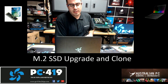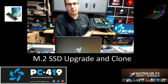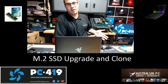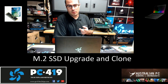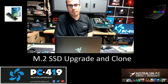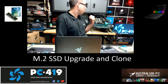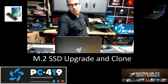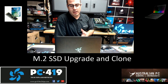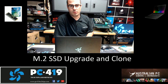So as you can see, it is a bit of a process cloning your drive, but it's not a very hard process to be honest, if you've got the right tools and the right software. If you've got a model that supports two M.2 NVMEs, you'll be able to do this in a 10–15 minute job. Mine's a bit longer — I've only got one NVMe drive slot, so I have to go from NVMe to SSD, then SSD back to NVMe — and as you can see, boot it up and it's straight to the desktop, no problems whatsoever.